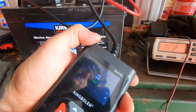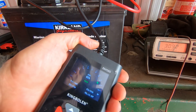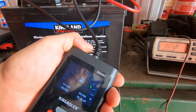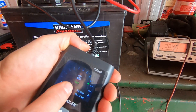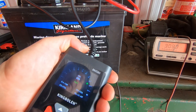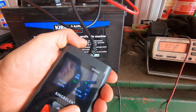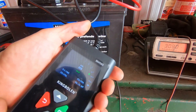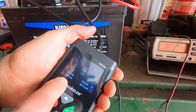After selecting that, it tells me the battery is 85% good. This is a three-year-old boat battery that's never been used, so I'm not surprised it's good. It shows 85% SOH, resistance of 4.14 milliohms, and claims the cold cranking amps measured at 620. The voltage reads 13.44 volts.